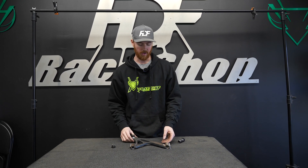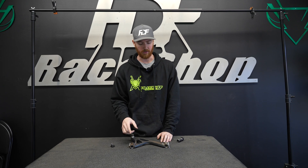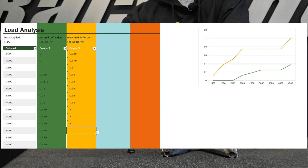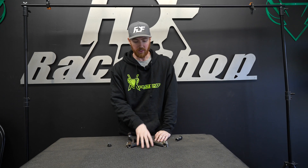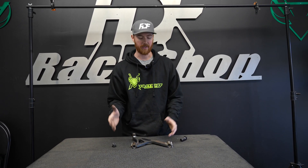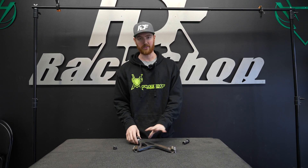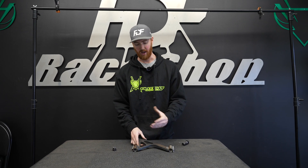At 4,000 to 5,000 pounds, original control arms come with rubber bushings and those things are just deflecting like crazy. Whereas this had almost no deflection — we can show the chart and graph right now. This arm had little to no deflection especially when loading it up. That's because this is a bearing-mounted control arm with solid bearings — there is no room for deflection. The bushing ones are going to move a lot, the rubber is going to compress on one side and extend on the other, the arm rotates and allows that wheel to move a lot. There's no comparison — this is a far stiffer and higher performance control arm.